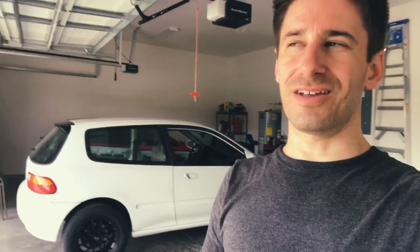So the only issue I had was, you know, I know the car was already pulling to the left, and now when I was hitting those brakes, it was like darting to the left. So that caught me by surprise. Like, that first initial high speed, I was going like 60 and went to hit the brakes harder, and it kind of jumped out to the left. So definitely got to get that alignment sorted, and hopefully that's the only issue with that.